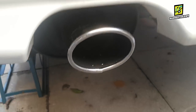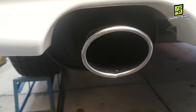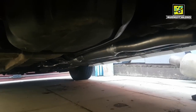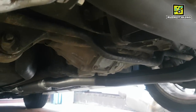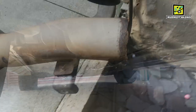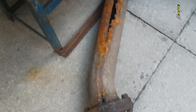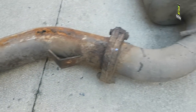I've put the standard exhaust on now. It looks a bit lost in there because I'm used to the bigger exhaust, but I do love the look of it and I'm glad I've gone for standard — it'll look miles better when the car's back down on the floor level. The exhaust is all in place now, all bolted up, just loose while I wait for the cat. I'll let you have a closer look at this exhaust where it snapped just after the catalytic converter. As you can see, it looks like it's rotted from the inside out — and it looks a lot worse now seeing as it's been outside overnight.